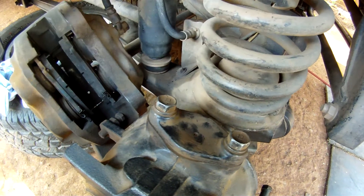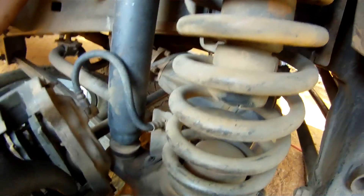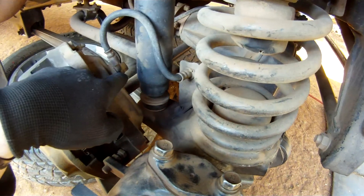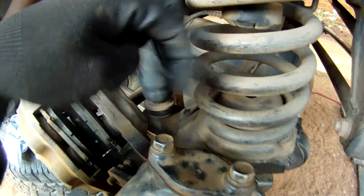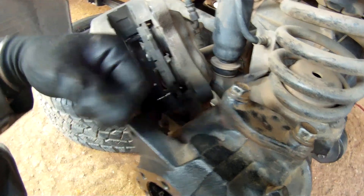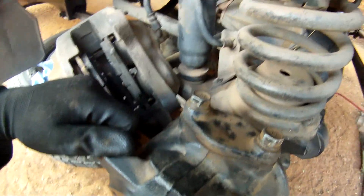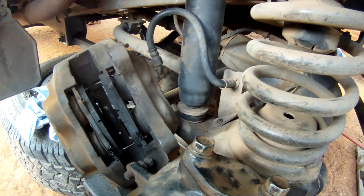One of the other differences is the brake pipe is not connected to the top of the top swivel pin. Whereas Land Rover has the flexible hose coming from here down into a bracket and then a rigid pipe back around to the caliper, Toyota have just taken the flexible pipe straight from the caliper down here — so they don't have to stretch it up as far — and then the brake pipes run on top of the diff with another flexible section. This is just so much better from a maintenance point of view. On the Land Rover you've got to split the braking system to be able to get the hub off, which is a real pain. Not having to do anything with the braking system is a real bonus — so by design Toyota win on this point because it's a lot cleaner and a lot easier to work with.